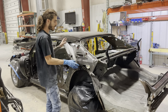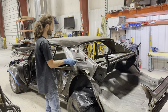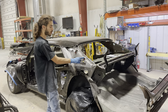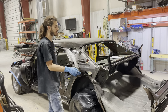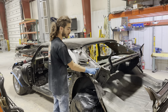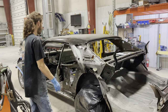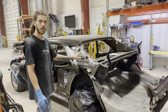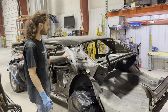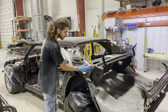It sounds counterproductive because it's bare metal. I hate doing it too. But it's the only thing that will actually neutralize the acid. You can try acetone and wax and grease remover, and it'll seem like it's neutralizing it, but it really doesn't. So you gotta use water. But hot water will stop it from turning a brownish tinge. It'll be more of a blue tinge from the zinc phosphate coating that'll be on it.